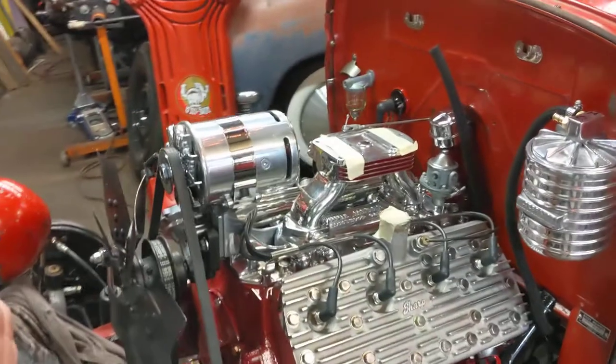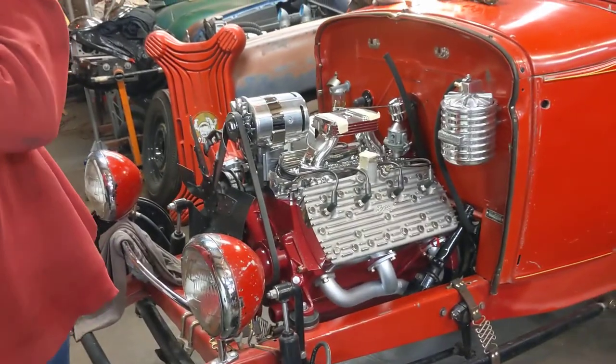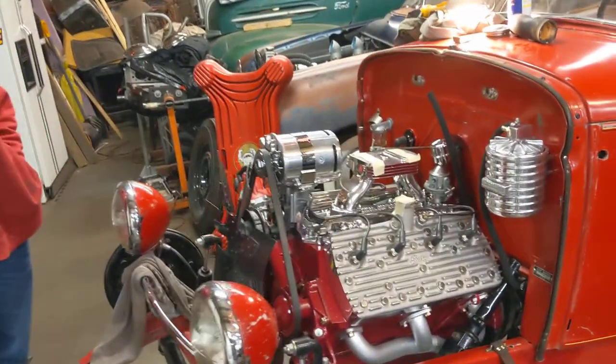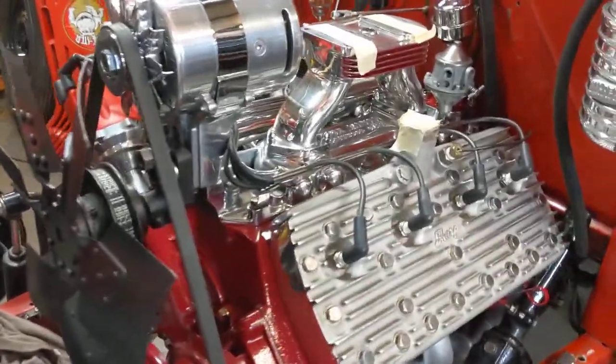It was mated up to a T5 transmission, but because the input shaft was not trimmed it was pushing into the motor and ended up chewing up the bearings. Wow, how devastating — but it'll be better than ever now. I repainted it.